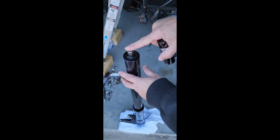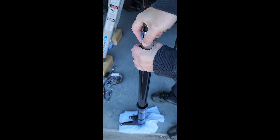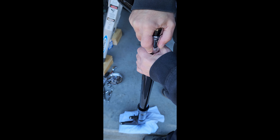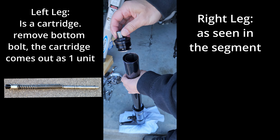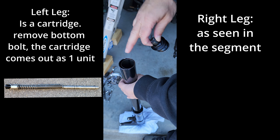After three years of ownership, this is the wear that you'll see on it — my bike has over 26,000 miles on it. It's time to take the fork cap off. Make sure before you remove it off the bike to take out all the preload, because you don't want the spring on the inside to be under a lot of pressure — there's a lot of pressure pushing up, so be very careful when you're removing this. Apply downward pressure as you are unscrewing so that when it comes out you're holding it down. It just released — I caught it. Use downward pressure and use your hand over here to hold it in place.